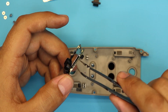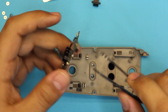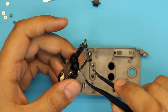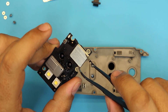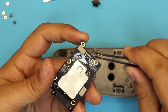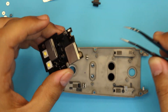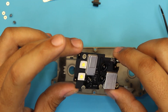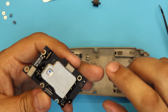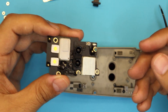If you want to replace your SD card reader, you have to heat up the whole plate on the bottom side, remove the cushion right here, and just replace it. Or to make it easy, you can order the part — there's a part number at the bottom — just order the part and replace the whole thing. That option is for those who don't know how to do any soldering.